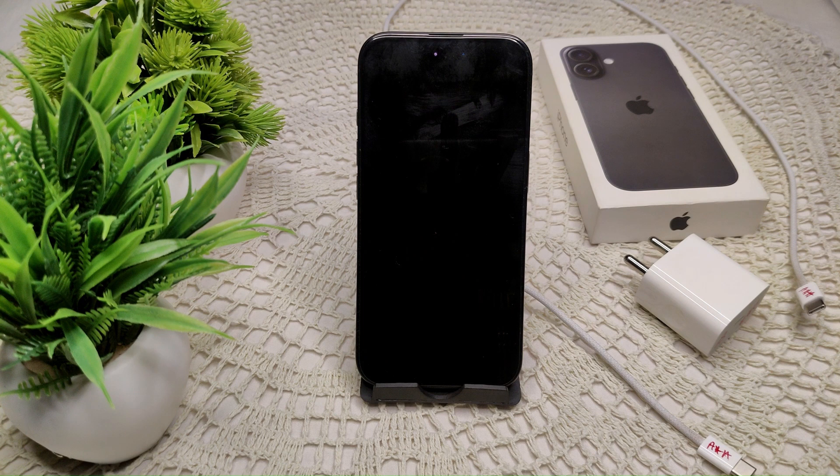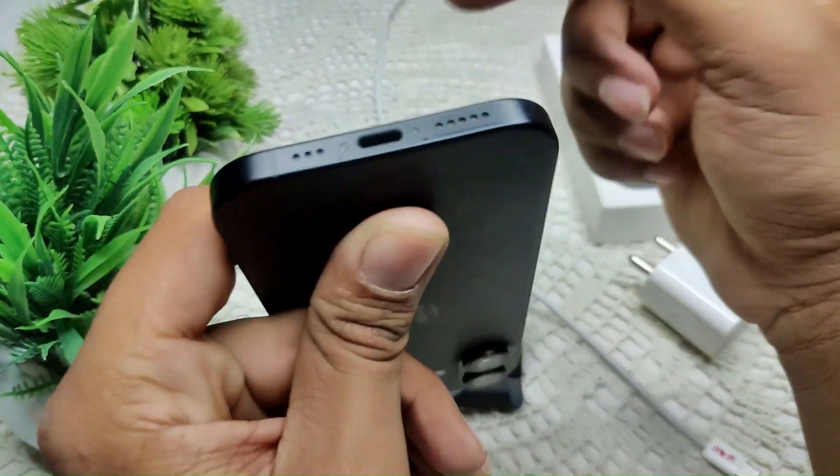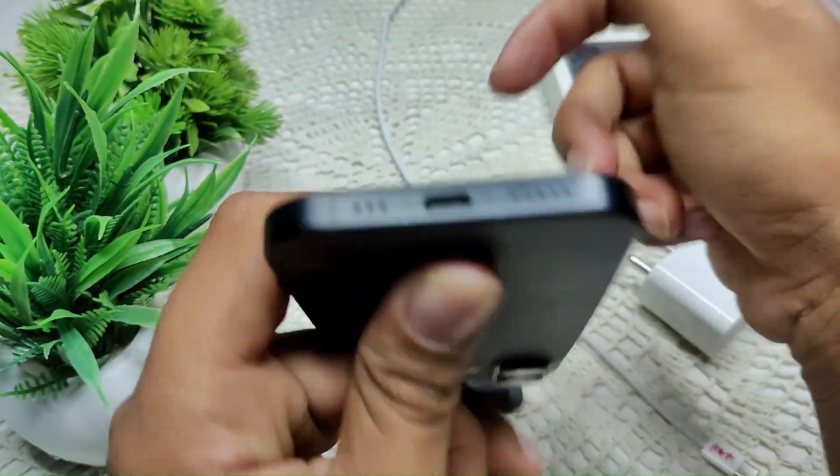We also have to test with another charging cable and adapter to see if the issue persists — a faulty charger can often be the culprit of not charging. We also have to clean the charging port. If there is some dirt or debris in the port, we have to clean this area.